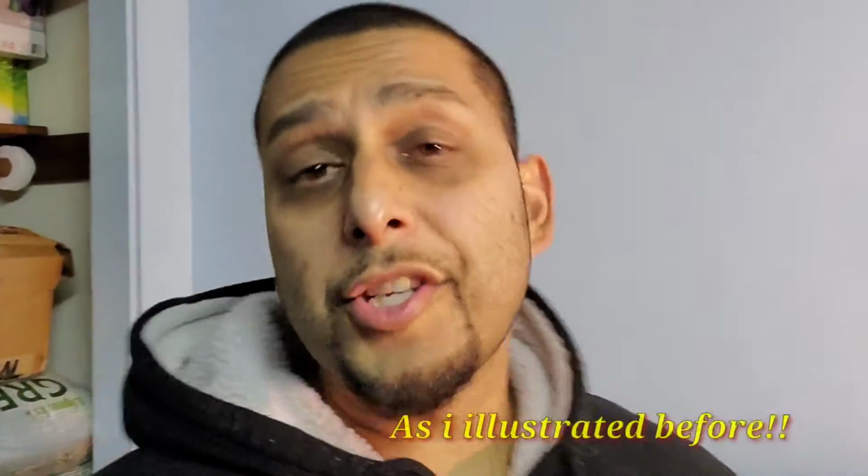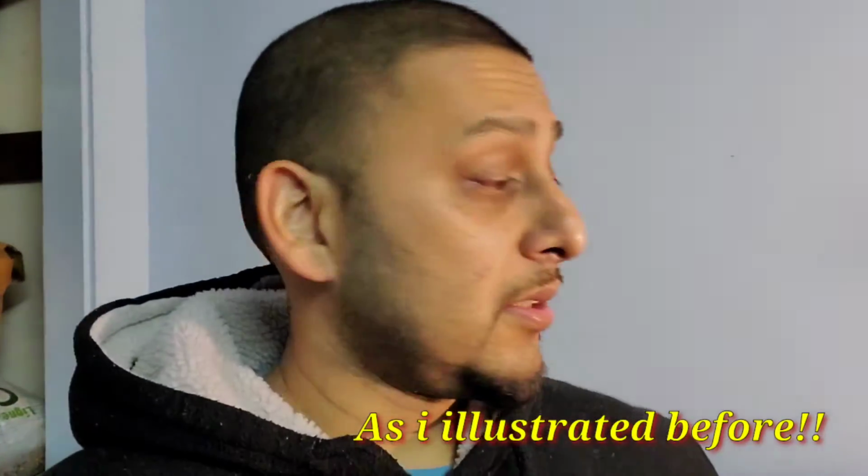All right, guys, it's around 10 o'clock at night. It's late. I've been working on this for some time now. I had to take off the bumper again. I'm a freaking pro at it. Because the pointy end of the bezels kept popping out. I contacted SMY Performance, and the guy, whoever it was, said, oh, you installed it wrong. Now, I've been installing stuff for a long time, and I know it's not wrong. He said you've got to put in the pointy ends first. But the problem is the way they made the tabs to latch on, it's so narrow, it's just slipping out. It doesn't matter which end you installed first, the fat end or the two pointy ends, it didn't even matter.